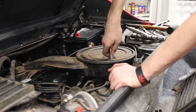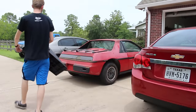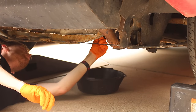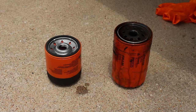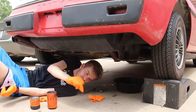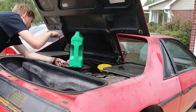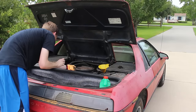With the barn occupied, I was out in the driveway to do an oil change. I did just do one a few weeks prior, shown in part 2, but it's good practice to do another one shortly after — especially for an engine that was sitting for a long time or after a fresh rebuild — to make sure all the contaminants and sludge are completely out now that oil has been cycling through all the engine galleys. I made sure to actually change the filter this time. The new o-ring was lubricated with some oil to make sure there was a good seal. Fresh oil was added and checked for level, but the car wasn't level due to being on ramps. After rolling it down to a level section of the driveway, I checked it again and needed to add a little bit more.